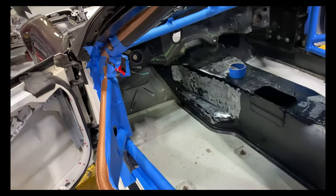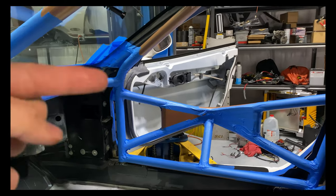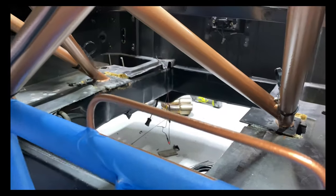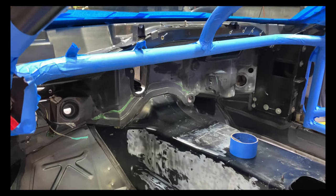I'll get started on prepping the interior. I've got most of the interior taped off. I'm going to come back through with some paper to cover some of the areas that I don't want to just tape 18 inches of tape onto. So what we have now is blue tape over everything. This would have been a lot easier if I would have known I was going to paint the interior. I'm only going up to that line right here. And I can lift the car up — it's actually really convenient because I can climb in the hole and stand up and do the back side area.